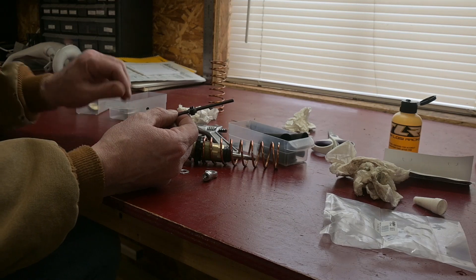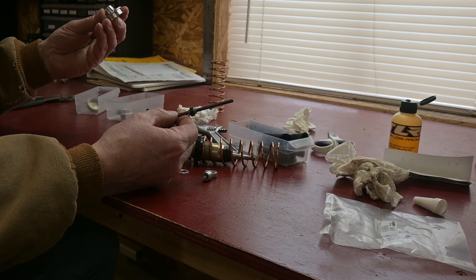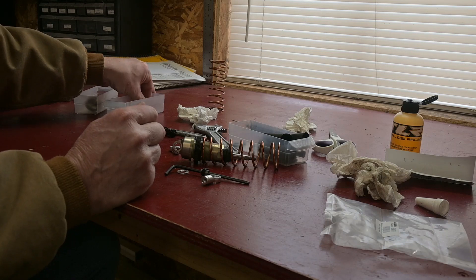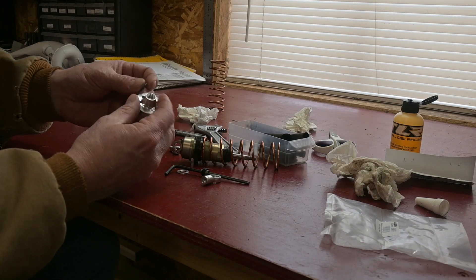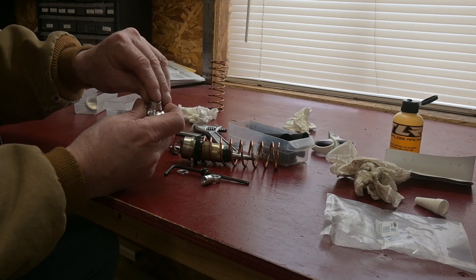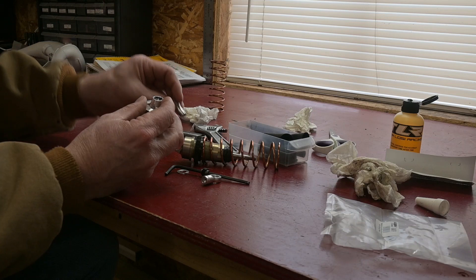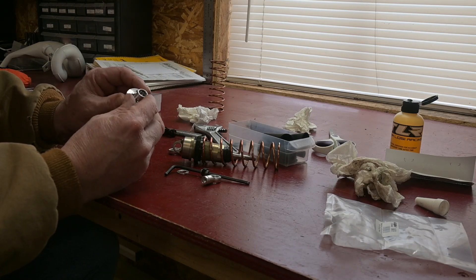Other than that, they're pretty straightforward. I didn't see any instructions anywhere on Fastlane's site, and it didn't come with instructions, so I just kind of made it up on my own. They did include these O-rings besides those Teflon seals. It didn't really say where they go, so I just put the O-ring down inside this cup here and used that as kind of a buffer between the two parts. It seemed like that worked, so between that and hopefully a lot of Loctite it'll stay in place.